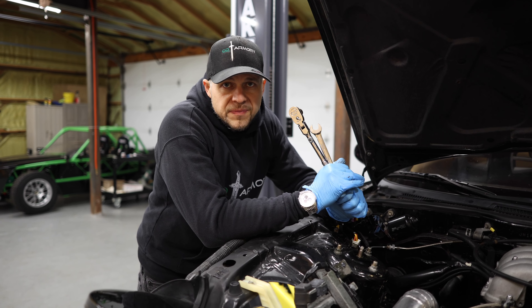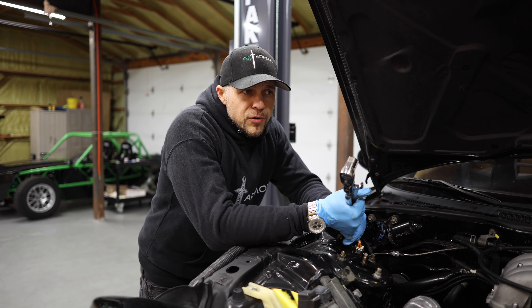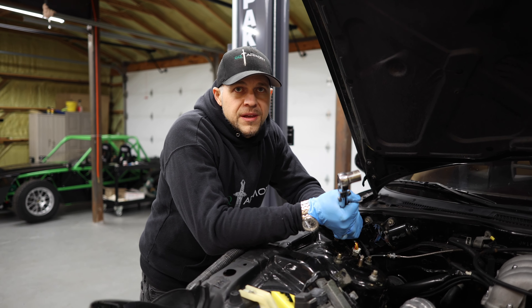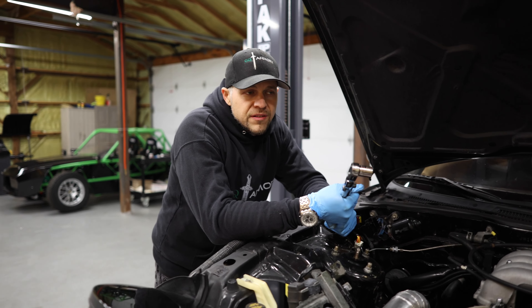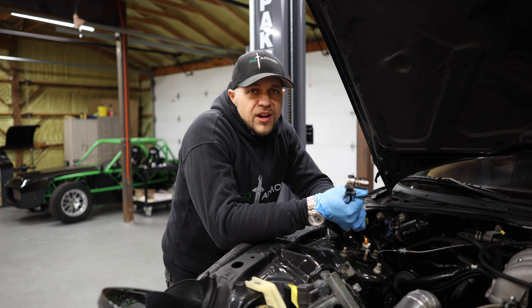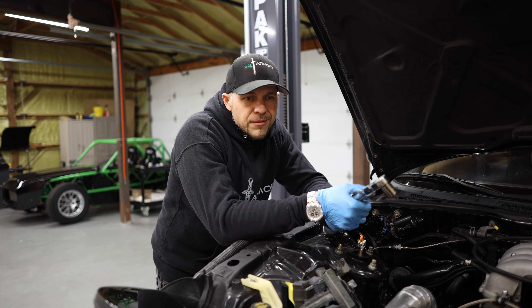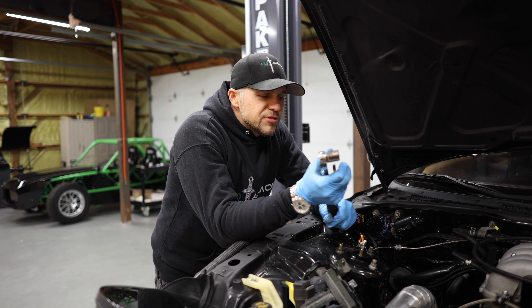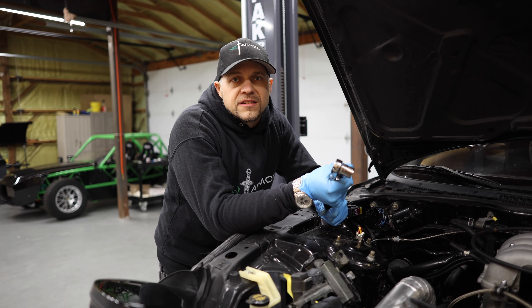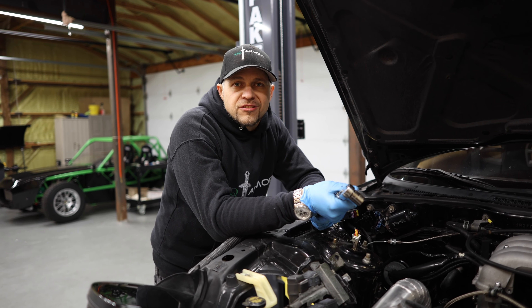I already went into my theory on why this was an issue, but for those just tuning in: I was never able to boost more than 15–16 PSI with this setup. I have a Greddy Profec B with the stiffest wastegate spring you can put in there — the red one. Doesn't matter what you do. You can pull the vacuum hose off the wastegate, it still boosts the same. We even took the cover off the wastegate and left it open to see what it would do — it built like 11–12 PSI. What we think is the smaller 57 trim cover volumizes too quickly and just can't get the air out in time, which is ultimately slowing the compressor wheel down.